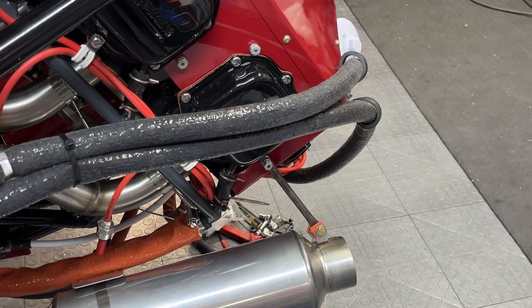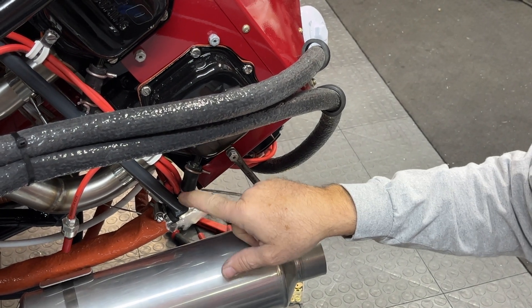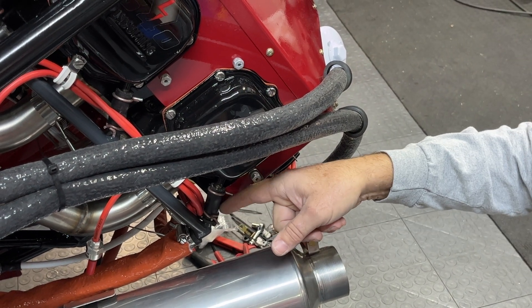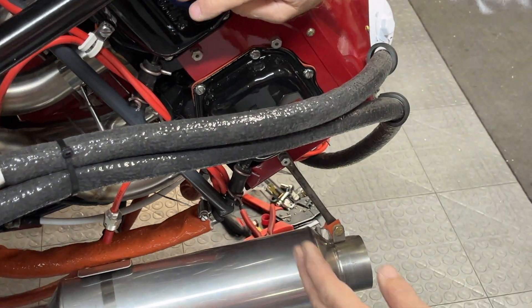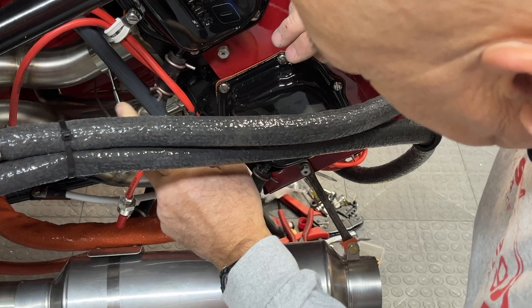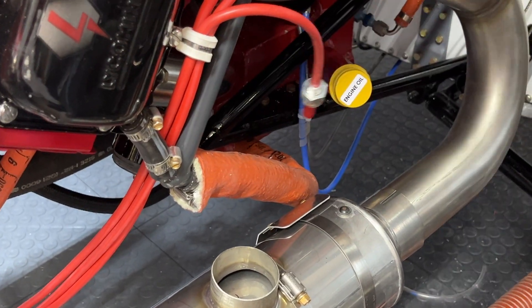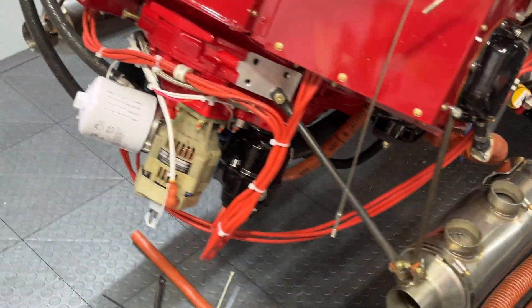I'm doing a little experiment with those oil drain-back hoses. On this side you can see constant-pressure clamps, which I've promoted in my books and columns — they put a nice uniform pressure around the hose and don't allow for leaks. On the other side I installed worm-gear hose clamps. I'm going to see which ones last longer. These will be easy to check regularly since they're a little hidden on a regular aircraft installation — just a bit of curiosity there.